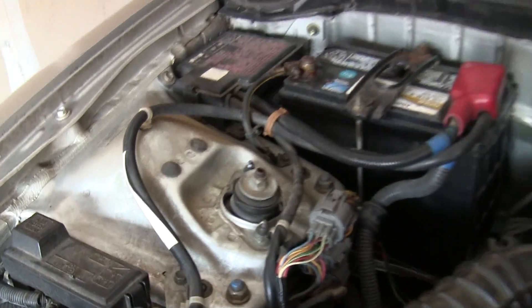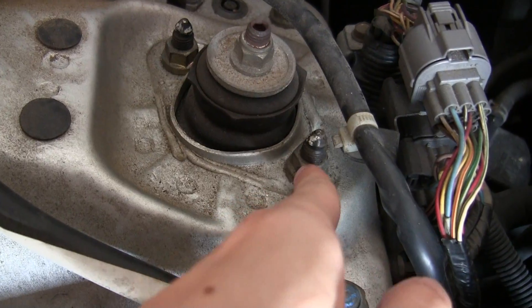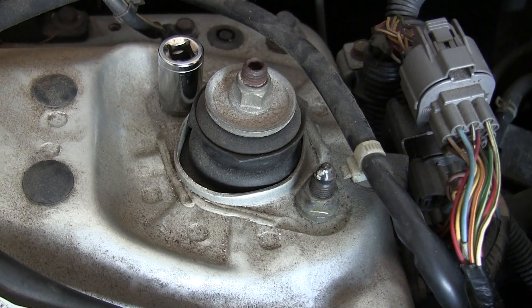So for the install, we're going to be connecting the front right strut tower and the front left strut tower. The first step is to remove these two bolts here and here — they're about 14 millimeters and they should be torqued at about 36 pound-feet.